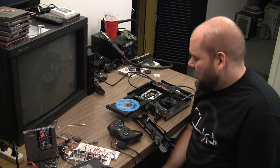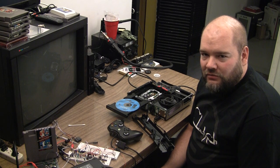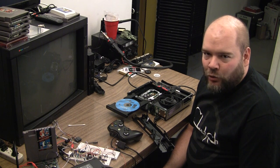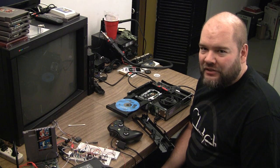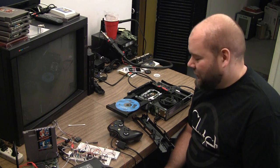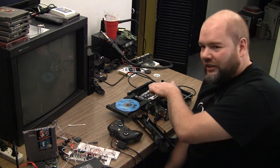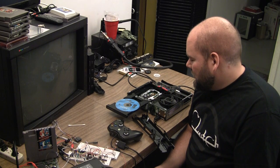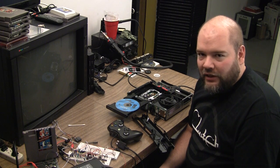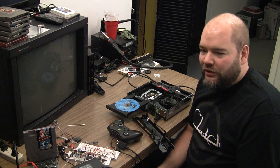This is a console of a good friend, and it turns out it's going to be a pretty easy fix. Basically what it is: you put a game in, it goes in, it doesn't do anything — maybe it spits the game back out, maybe it just stalls. A lot of people call it an open tray error. The issue on this one may not be as common, like the lens being dirty — this one was not dirty, the laser sled was not stuck at the rear, and it was lubricated fine. I did have one major hint, and I spent about two hours on YouTube looking for videos of similar problems, finally found one and it clicked.